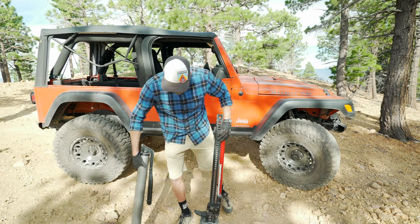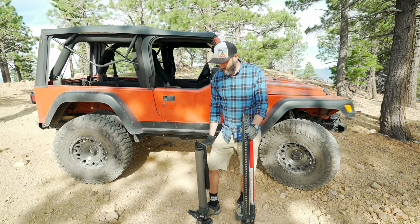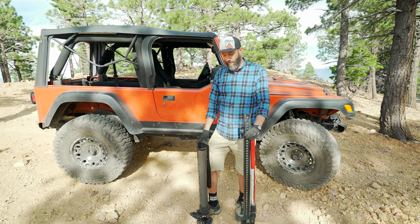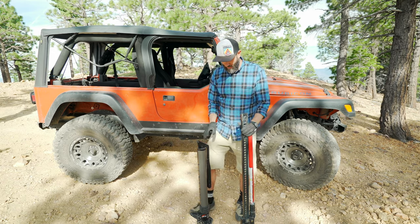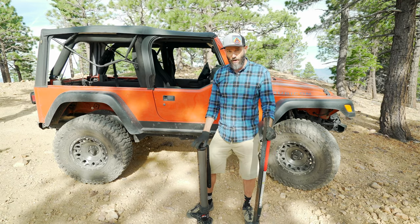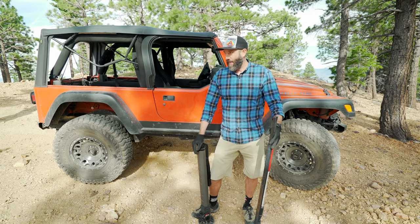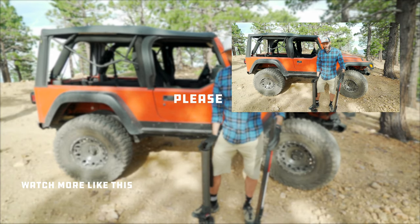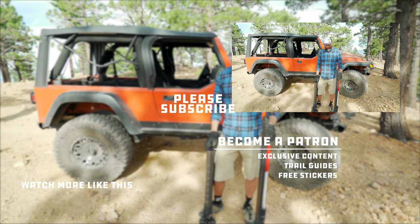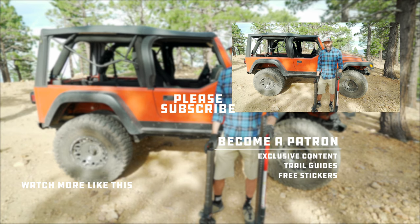The ARB jack is very easy to use, not particularly dangerous, and very stable — but it's very expensive. It works really well on rear bumpers to jack your vehicle for whatever reason. But if you ever need to use it as a winch or jack sideways like people do with a high lift jack, this one won't do that at all — Harry's tried. I personally have never needed to do that, so it's probably not something I'd worry about. I also don't have $800 to spend on a jack — the high lift is about $150. That in a nutshell is the ARB hydraulic jack. Let me know in the comments what you think about my assessment. Thanks for watching and happy trails.